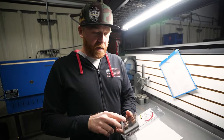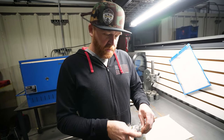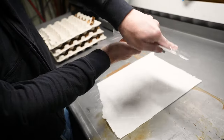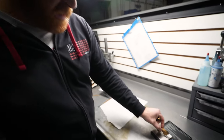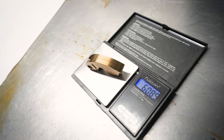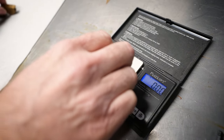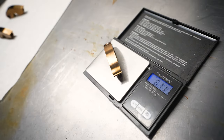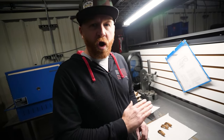High-energy clutching — precision is the name of the game. We pulled these off the shelf just now; these are 61 grams, so they would be appropriate for an NA 850. A tenth of a gram light, a tenth of a gram — and look at that, within a couple hundredths again. Within a couple hundredths — that's how we precision batch all of our clutch weights.